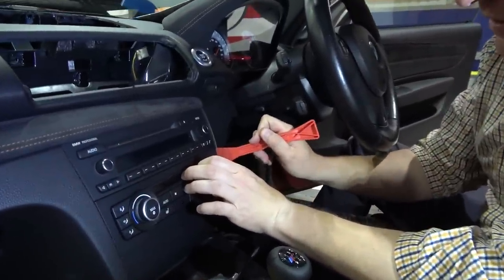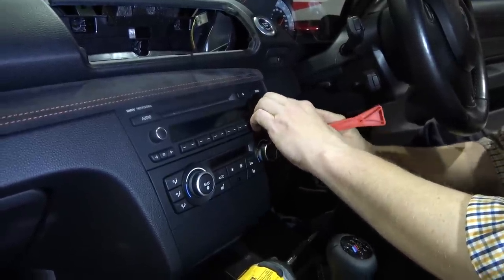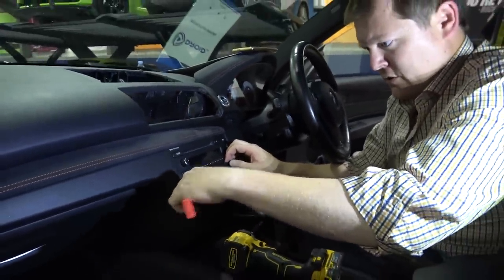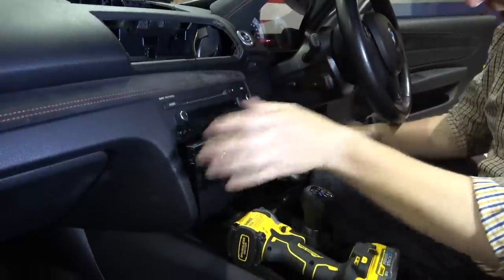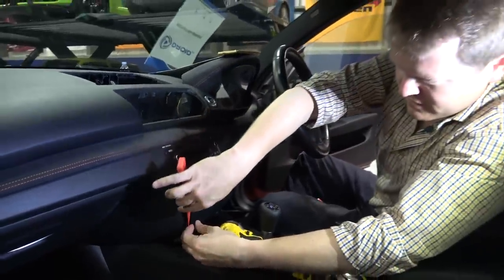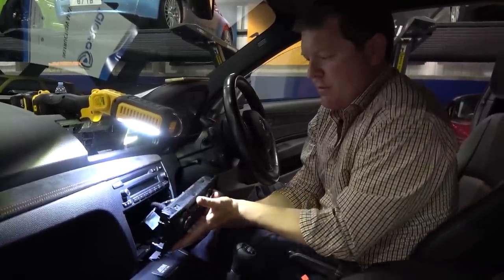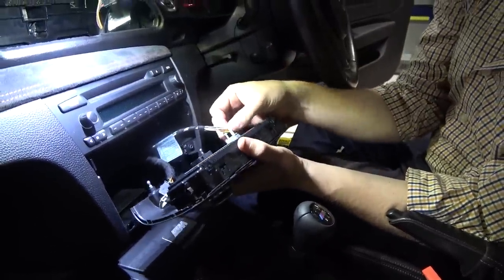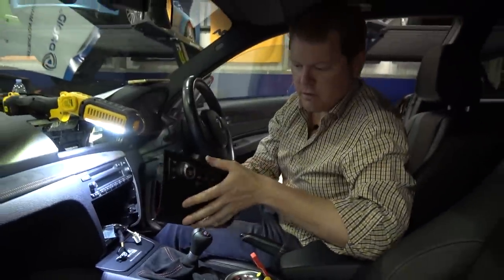With that out, next up is to remove the climate control, which I believe the whole thing should come out in one — just prising it from here. It's starting to move. The same on the other side. Get the whole piece to come out. There we go. Not just the fascia from there — pull this out. There's quite an empty space behind there. This reminds me of the old days — this is exactly what I did with my original one to get the Bluetooth in it. A little reposition, that tray from underneath is removed, we've got a couple of clips taken out. These cables on the back — you kind of flip over the top part and they release. And then once pulled away — there we go. That means we can pop this to the side.